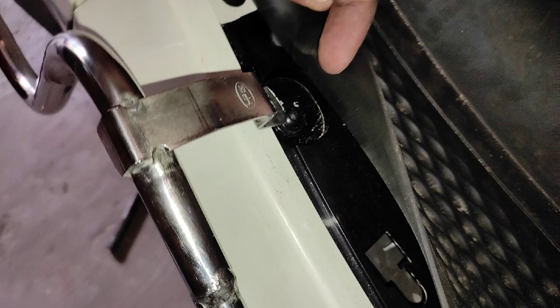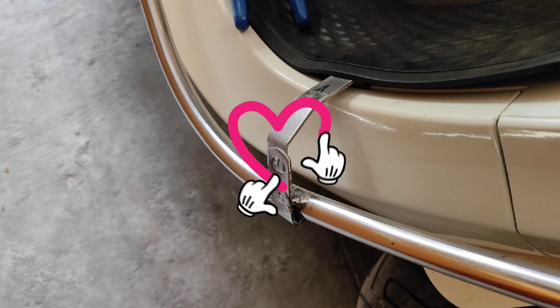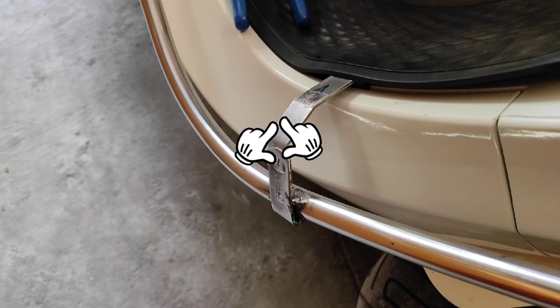Place one cloth on the legroom to avoid scratches while fixing the guard. Now we are ready to engage the front and rear guard together — this is the place where they couple together. Remove the Allen screw for fixing the center clamp of the rear guard on both sides, with the help of the 6mm Allen key available in the tool kit. Now tighten the front and rear guard and clamp with the nut and bolt given in the kit.